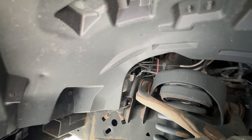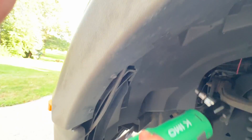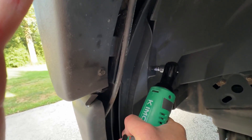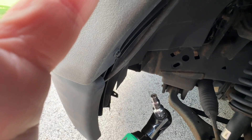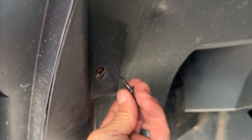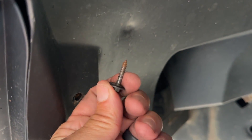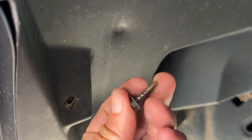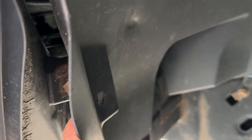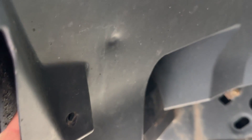Take out these bolts — I have a little electric ratchet. The size of those bolts is 7/32nd. The lower screw wouldn't come out easy. I'm in Pennsylvania so obviously there's rust on it. I just stuck a pry tool back behind there and applied some pressure pulling on the plastic while I backed it out, and then it came out.